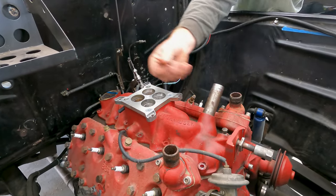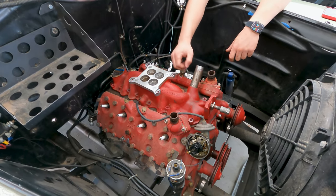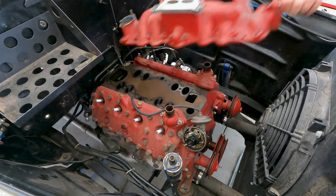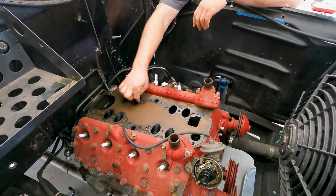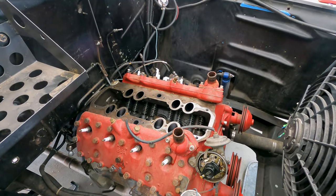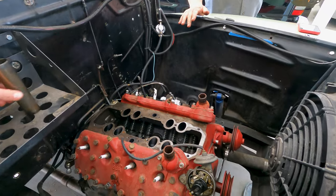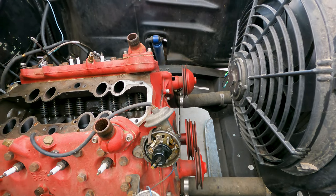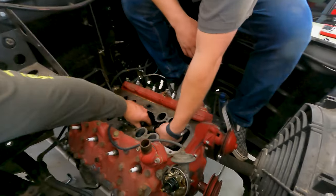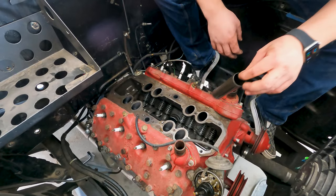It's ready to be free. Flathead motors — you have literally flat heads under here. Look at how easy that comes up — that was crazy. Look at that — how cool is that? There's your intake ports for each cylinder, and then you pull this up and there's all your valves. There's no rockers, nothing. Wait — did that come out of the head or the manifold? Interestingly, this was down here in the valley. That's a very good thing we're taking this apart.